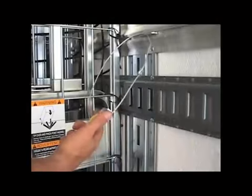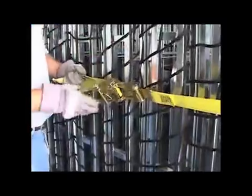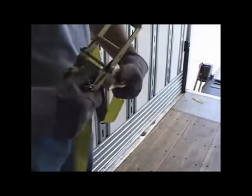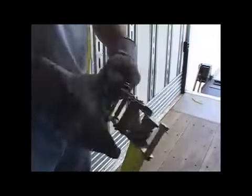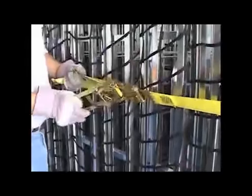First, lock the E-Clip end into the E-Track Rail. Then connect the two sections together in the center. When locking these two connection devices together, it is important that you attach the connection hook to the center bar directly adjacent to the flat metal surface — this is the only correct position. Once it is attached, pull the excess strap through the ratchet spindle, tightening the connected unit.